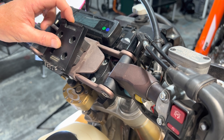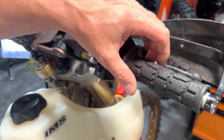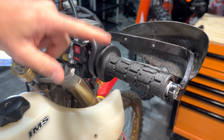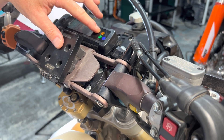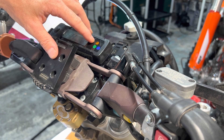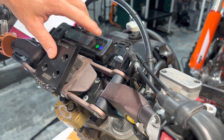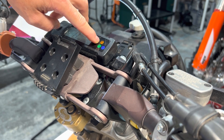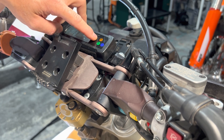The next step is to do the zero throttle — the fully closed throttle position. Make sure you're completely closed. Throttle is all the way in the closed position. While watching the light, I'm going to touch the trigger lead a second time to the negative battery. That puts it into program mode for zero percent throttle. The light went steady for about two or three seconds — that's when it was learning. Now it's flashing again, telling us it's ready for the next function.